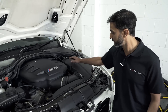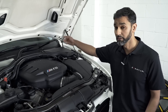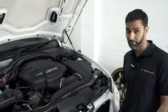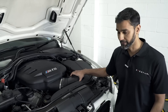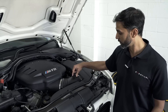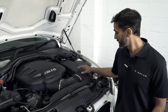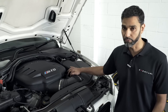The airbox itself has an exit at the back which connects to the bonnet, so as you're driving, hot air is literally pulled away from the bonnet with cold air coming in from the front. The tube of the airbox has flex in it because the engine moves and the airbox is rigid, so you've got two concertina portions of the tube. Other than that it's a very good design — it's got good volume inside the airbox and it's obviously sealed from the engine bay heat.